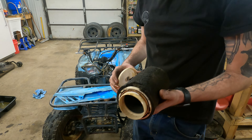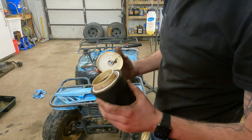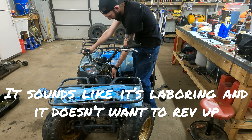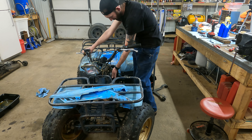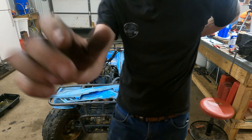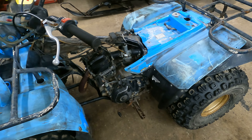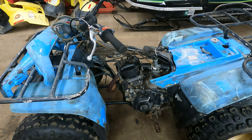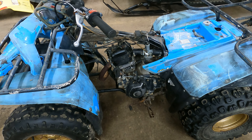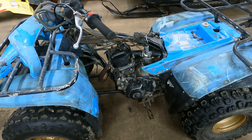I never checked the air box — it's saturated with motor oil. Calling it a night. We did get it to fire up but it's laboring hard, just kind of half-idling with the idle screw cranked way in. Worst case scenario is that moisture in the bottom end seized up a bearing, making it harder to rotate. But when I had the top end off, the rod felt good and the crank spun normally.